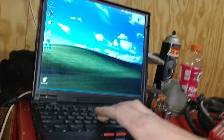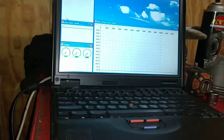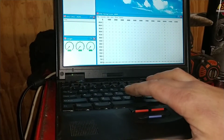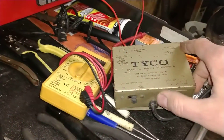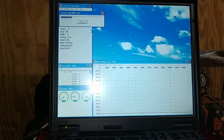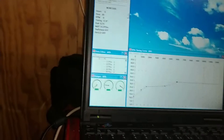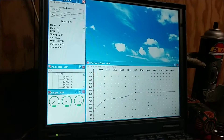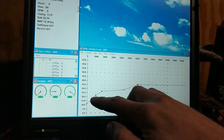When you buy the MSD controller you're going to get the software. You open up your MSD View, restore — boom. So there's nothing here. Turn on the power and look at this — everything comes to life. Here's the timing curve. The timing curve is really, really weak. They started off at like 11 degrees just about idle, and then they give you about 36 total.